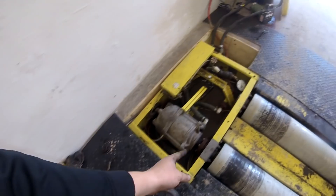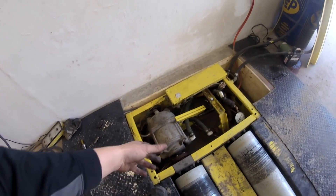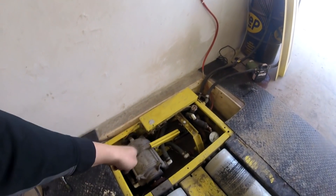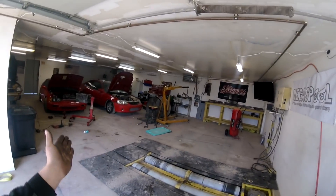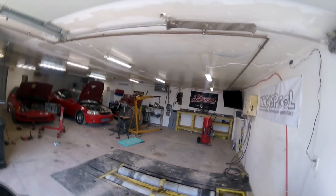There might be a small drip once in a while off the front seal. I may take the brake apart and redo it — run bigger feed lines and return lines off the water brake because it is a little slow to engage the load. Darren Lobb on his YouTube channel upgraded the lines going in and out of the brake and says it helps tremendously with how fast you can load the dyno. When we have turbo cars in there, if the boost comes in you want to hit a button and have it cram the load so it doesn't blow through the brake.